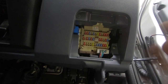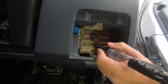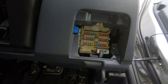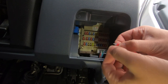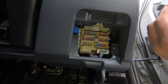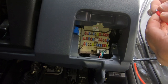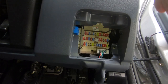Another way — I don't recommend this, but it is another option. If you DIY guys are trying to save money, you've got spare fuses here. You can tap the wire onto the fuse leg and put some solder on that, or even worse — wrap it. I actually fixed a job where someone had done this. I don't do this or recommend it, but if you're doing your own job at home and all you've got is a fuse, it's not the worst thing. At least you're getting fused power.